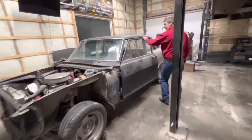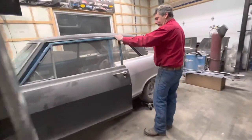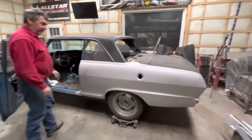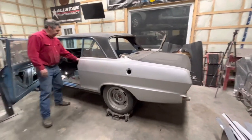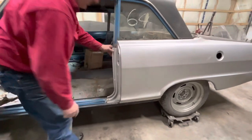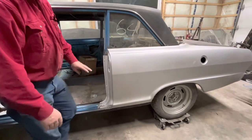So we flexed it on the ground, putting a block of wood under the area we wanted to lift, and stepping on the edge carefully so we didn't crease the skin. It turned out quite well and I don't think we did any damage, which was a miracle — but it looked crude as hell. It would have been a video to make everybody complain. Then we cut the quarter panel off and reset the new panel, tried to line everything up, and everything is sheet metal screwed in place. That gives me a lineup point to put everything back.